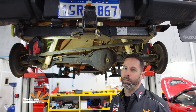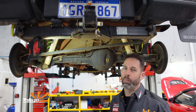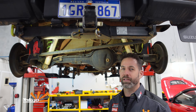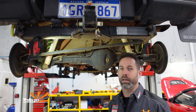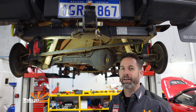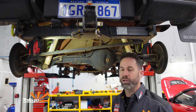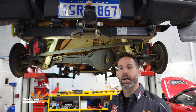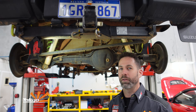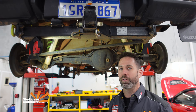Here we are under the Jimny and we're going to be doing the gear oils. I've already checked the gearbox and the transfer case. As part of chasing a little issue Tony's having with his gearbox, we've already changed those oils before this service — they take a 75W specific gear oil, which is quite thin. We're going to concentrate on the front and rear diff oils. They both usually take a 75/85 gear oil, but we're going to use a 75/90 — the Motul Gear 300 — in the front and rear diffs.